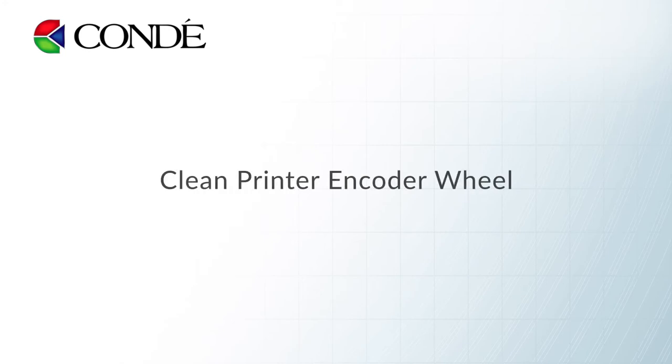Finally, there are some parts in your printer that, as the printer ages, likely need cleaning. I have great videos to show you how to do that. The first is your printer has what's called an encoder wheel. You have to remove the panel on the side of the printer, but this wheel can get dust on it. If it gets dust, the printer doesn't understand its actual location as it moves down the page. Cleaning the encoder wheel often resolves banding when other things are fine.